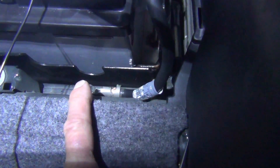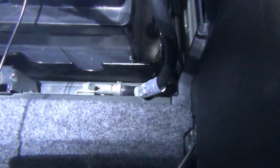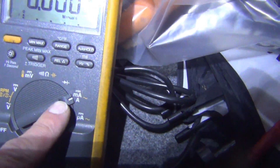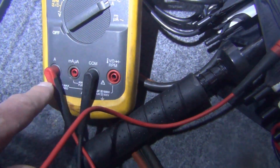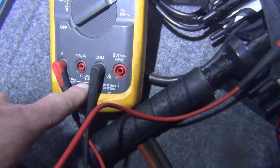There's a reason it's showing zero — it's because the ground is still connected. It takes the path of least resistance and it's not going through my meter, which has higher resistance than the ground. So I actually have to disconnect the ground, which will then feed current through my voltmeter. I'm going to want to be in the milliamp setting — make sure you're on milliamp. Also make sure you're in the amp setting correctly, because if you hook this up wrong you will pop the internal fuse.